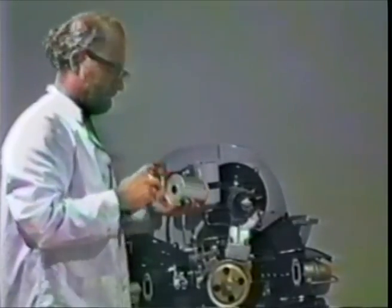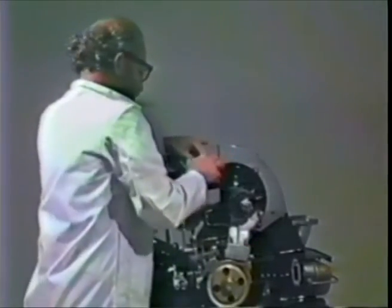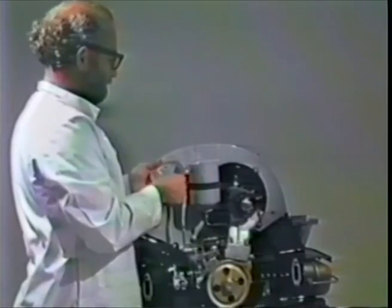Okay, now the next thing we need to do is get our oil filter can, and there's various brands, Mann and Fram, Purolator. You lubricate that with WD-40, stick it in. The gasket that comes in the oil filter can, or oil filter gasket here, sometimes will fit the lid. If you want to be certain, Stoddard Imported Cars has the right type of gasket.